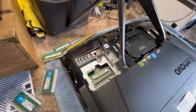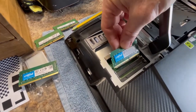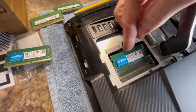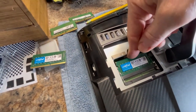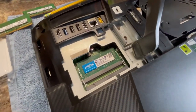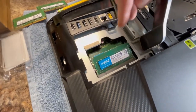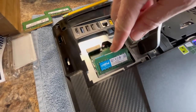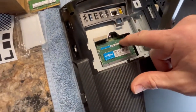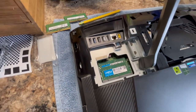Let's get back to replacing the RAM. Take the first new module and just slide it into the slot like that, push it in a little bit — it goes in there really nicely — then just pop it down. It's as simple as that. This is one of the easiest upgrades you can do to pretty much any computer. In all my years doing computer work back to the 90s, this is probably my favorite because it's so simple. Pop them in, double check they're all seated properly, and we'll button up the case.